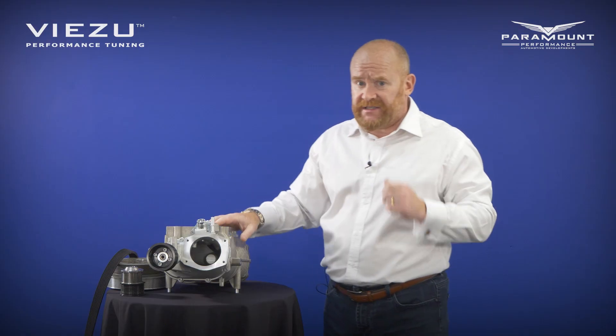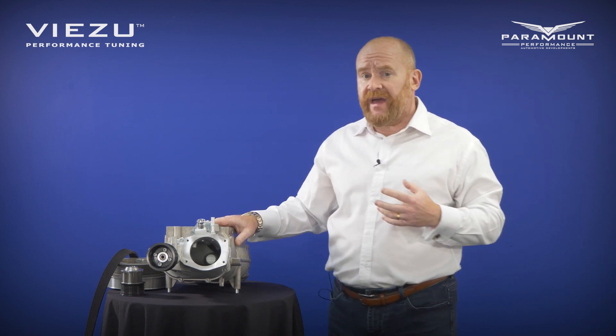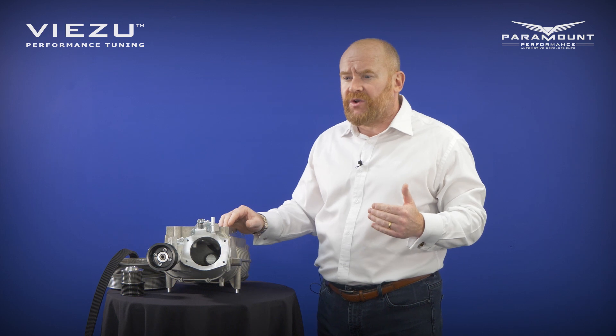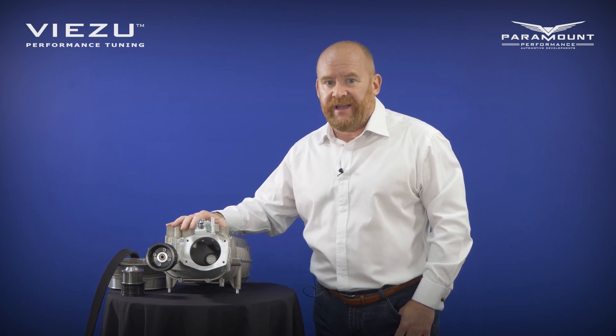The other thing that goes wrong with these chargers are the front bearings mounted here. This is a bit more serious. You'll know they're starting to go because you'll get a gravelly noise from the top of the supercharger — it'll be there all the time the engine is running. It can be quite subtle at first and you might not hear it over engine noise, but it just gets louder and louder as the bearings wear more. It's important you don't ignore that. If left untreated, the bearings can actually break up, and as your supercharger is working it will fold the broken bearing material directly into your engine. This can cause immediate and catastrophic engine failure.